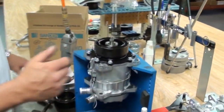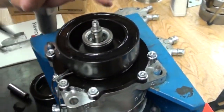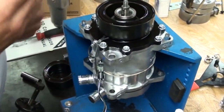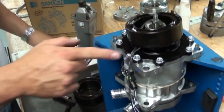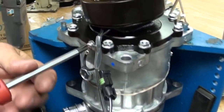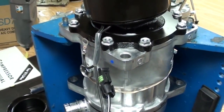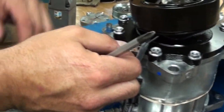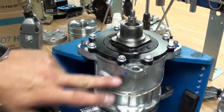We've got the pulley off. Now we've got to take the coil off. The coil is held onto the nose of the compressor with another external snap ring — pop that off. The coil is free, but at this point we need to pull off the coil retaining wire clip. There are two types of coils in Sanden: an internally grounded coil and an externally grounded coil. If it's externally grounded, the coil grounds out to the nose of the compressor, which is a steel nose cone on an aluminum body.